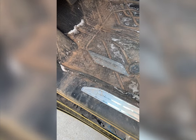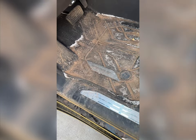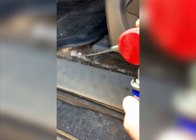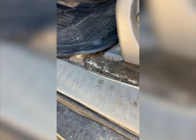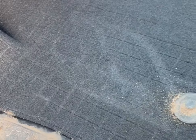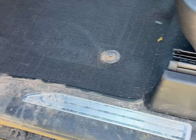If those salt stains leach down onto the carpet, which they usually do, it causes an issue. They tend to look like white residue and won't come off even if you vacuum them. So take WD-40, soak the salt stain, and let it sit for 20-30 minutes — that'll loosen up the salt and you'll be able to vacuum it right off. That's why I'm a firm believer in those WeatherTech-style mats — they hold up well against all kinds of junk.